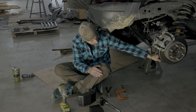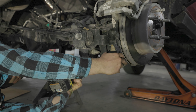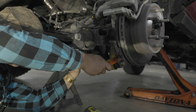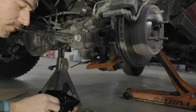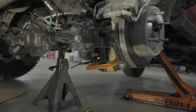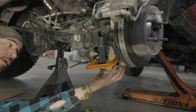I'm going to use the impact with a 27. I'm going to come over here and feel for that bolt to end right at the end of the nut. Now our goal is to try and get a gap here big enough for this 3/16 piece to go through. We're going to have to tap on the end of that bolt — try not to scar it up. Just tap it. There we go — see how it moved? Now that the bolt is loosened up and you have a nice gap there.